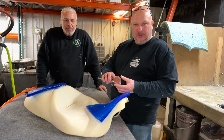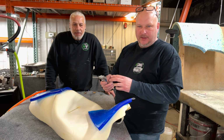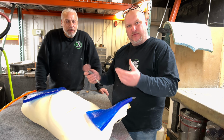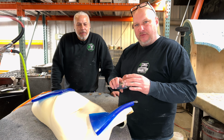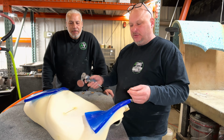2.5-inch disc too. And these are good because they don't get you into as much trouble. I am using a coarser grit that really cuts it, because as much as you'd like to use a small, finer grit and take forever on a seat, people do want their seats, so we have to do it productively. These cut it in the perfect amount of time so that we can get it shaped quickly and done quickly so people get their motorcycle seats.